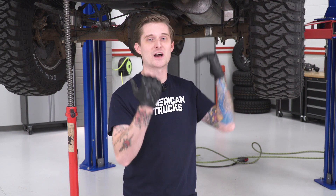We sprayed down all those rubber isolators so we can free up those exhaust hangers. You wanna take your time when you push this thing back because once those fall out, that entire exhaust is gonna be coming down, so have a friend with you if at all possible. If you're doing this by yourself, a good way to go about it is to let the tailpipe rest on the axle itself, then you can get some leverage up front on the mid-pipe, and you can slowly drag the entire exhaust out from underneath the truck. Just take your time with this one.